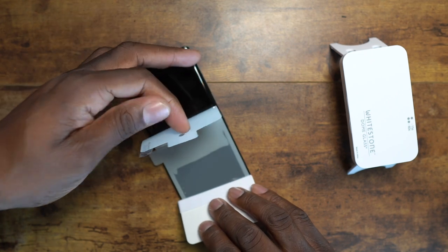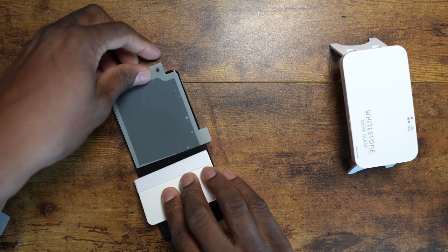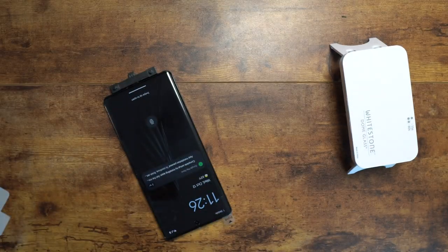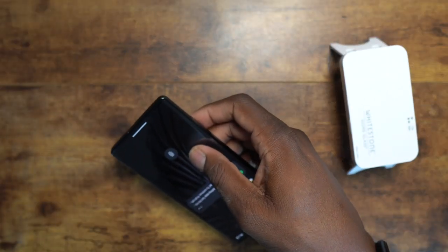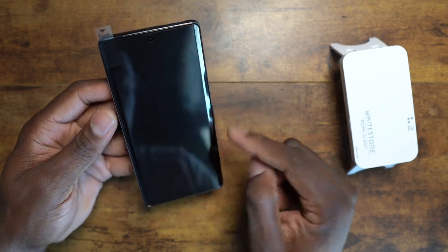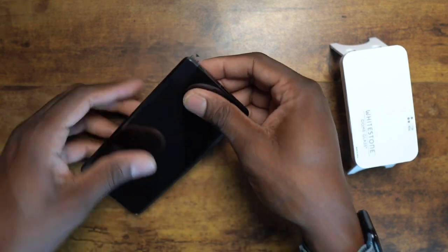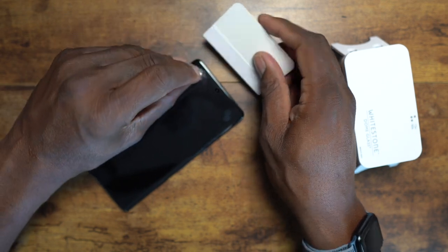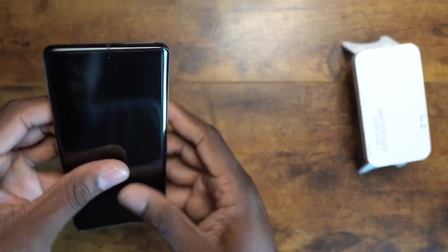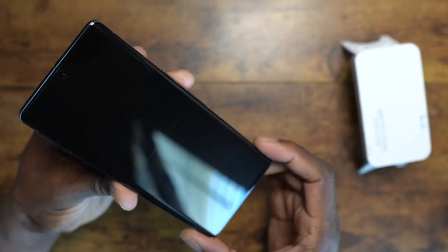Let's just go ahead and go in with it. You can go ahead and lift this side up — and just like that, you can go ahead and take this off. Get all that out of the way. This top portion right here, before you start doing some serious lifting, just make sure it looks good. Then you can go ahead and rub down on the sides here. Because this is a curved display, you want to use the UV light to really get it to stick afterwards. Make sure you always use the squeegee here to guide it, just to be sure I don't do any lifting of the screen protector. And then it is on. You can hit it with the UV light after the fact, just to get those curved sides down. But there's a little crease in the center there — that goes away over time from what I've seen.